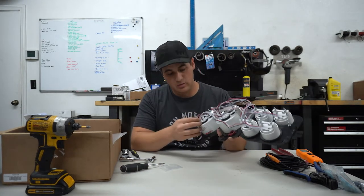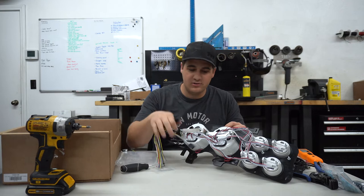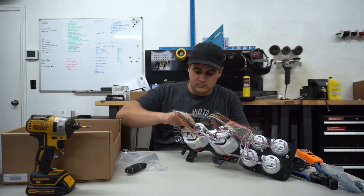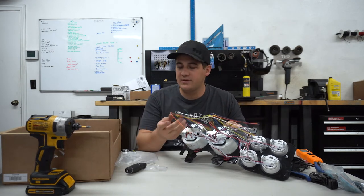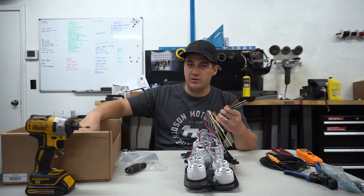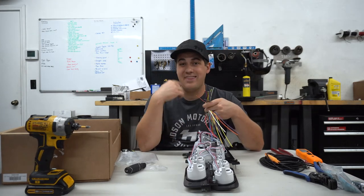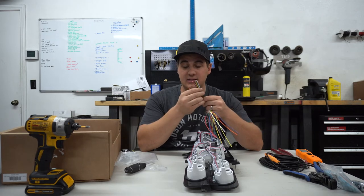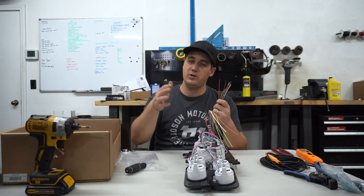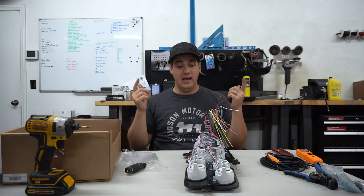Now that that's all wired in, we're going to put in our main wiring harnesses. It's the same color on both harnesses so it doesn't matter — they just plug in here to the back, super easy. They'll snap in and then we're ready to go put this in the truck. My own personal opinion — I would label these right here at the table with just some tape and a marker. Label what they go to and then go put them in the truck. That way you can quickly and easily reference your labels without constantly referring to your manual. I went through and found the colors and labeled everything. I'll do that, and then we will go put these into our Suburban and get them wired in.